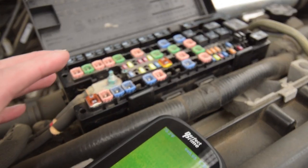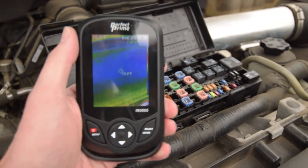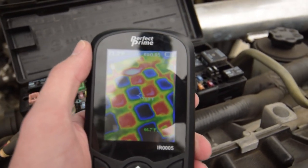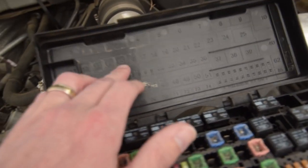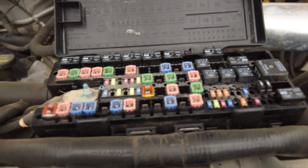So we're here out with the truck. One of the ways you can use the thermal imaging camera is if you had a circuit that was open and was running — you could go through and scan, look over the relays and possibly the fuses, and see if maybe one of your circuits is open. Cross reference it with the wiring grid — but that's one of the many uses.